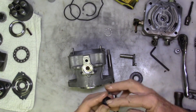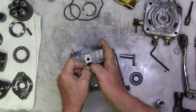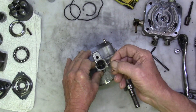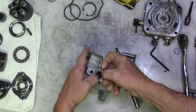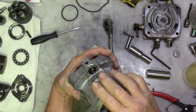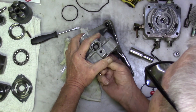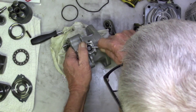This next step is kind of important. You need to install the small seal and clip on the side and slide the rocker shaft through it before you put anything else in the case — it will only fit now. If you install the long shaft first, you won't be able to put it in. Push the seal in with your thumbs till it bottoms out. The clip, on the other hand, you have to take your time with — it's kind of difficult and I don't know any easy way to do it. Make sure you line it up in the center and that all the fingers are bending at the same time as it goes down. It's crucial because this clip keeps this seal from popping out. The seal has a double lip and fits very tight around that shaft. When feeding the shaft through it, I had to give it a little help with a pick, being very careful not to damage it and to help it around the outside edge of the shaft.